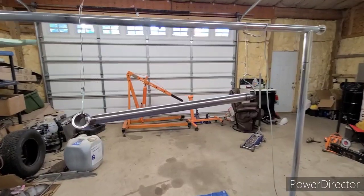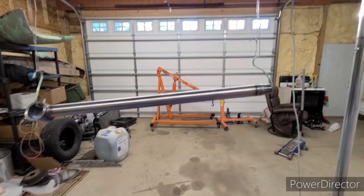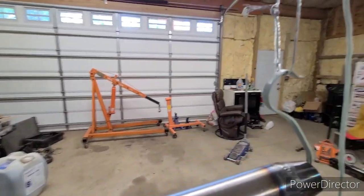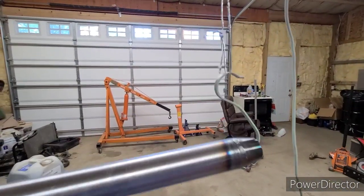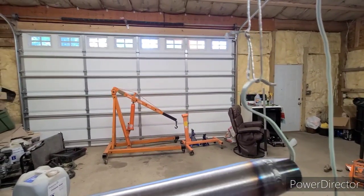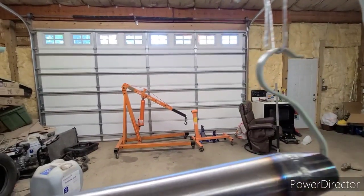I have the part hung up right now. I have coated 2 parts already, so these hooks are going to hang in there and bake with it, and the powder will actually bake to those hooks. So you have to clean them up a little bit, or just buy extra hooks. I didn't, but clean them up with a wire wheel. As you can see, it's a little bent because the wire wheel grabbed a hold of it.